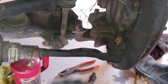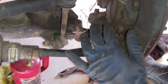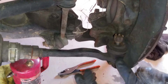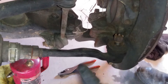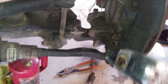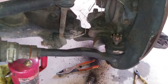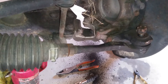If you're going to be reusing the tie rods, I'd recommend putting the castle nut back on right here so we don't damage any threads. Then get a pretty heavy hammer — I'm using a four or five pound hammer — and we're going to hit this knuckle right here where the tie rod goes into. Usually it gets compressed over time and gets stuck inside, so once we start hitting this with the hammer, it should pop out.